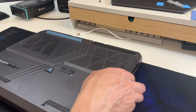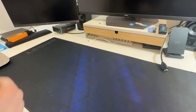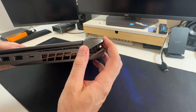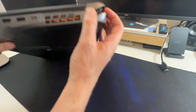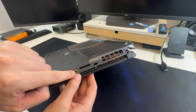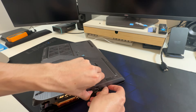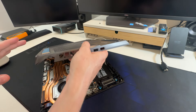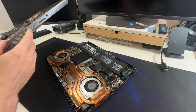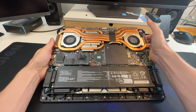Inside the laptop — I just took out all the screws here. I'm pretty sure you literally just take it off, it's no big deal. This little butt-top piece is just kind of sitting there so you can pull that off and then just pull down like that. You can see there's the headphone jack — you probably want to go from the other side and pull up from here, then release that way, because otherwise you're going to pull the port up and cause some damage.